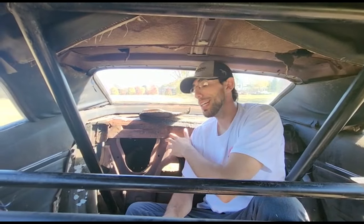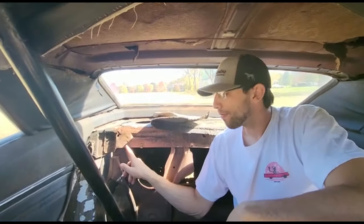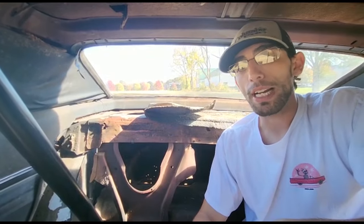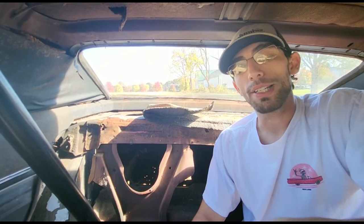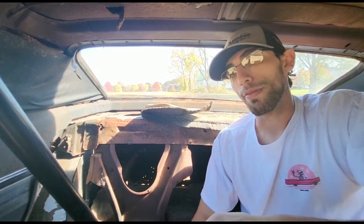The most important thing that we can do for a Norwood assembly-built car is actually remove the rear seat and take a look at the bulkhead. Right here we can see that there's an X and that there's a 3. It's in a blue grease pen, and sometimes they're in yellow. And what that means is that this car was an X33, which means it was a Z28 from the factory.